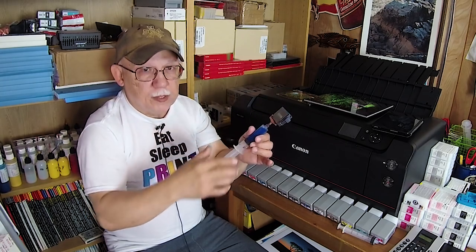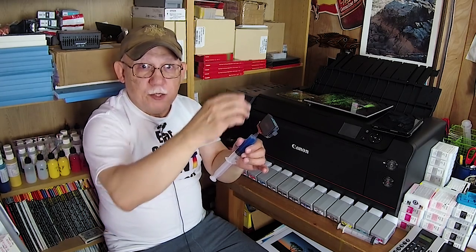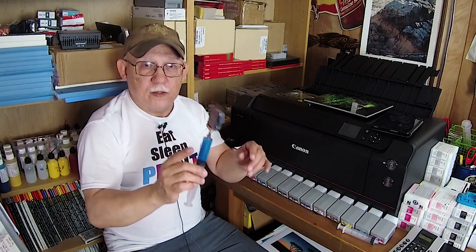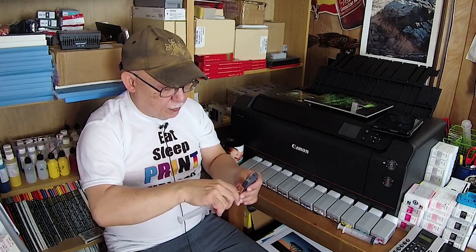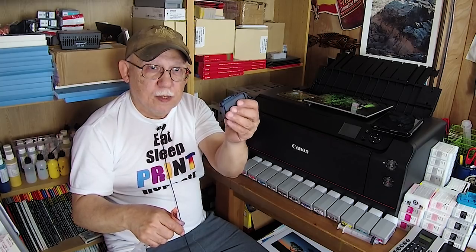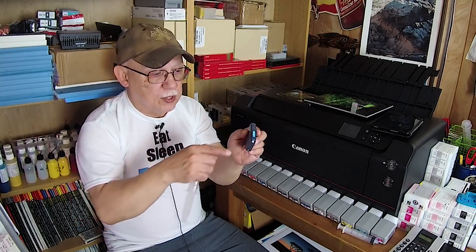Go to your sink, empty that out — fresh water, pull back, throw out; fresh water, pull back, throw out; fresh water and so on until the cartridge is flowing clean water. That way the cart is now completely flushed. If you try to fill this using the drip method you may have a problem, especially if the bag is not fully collapsed.